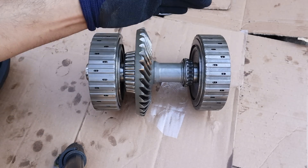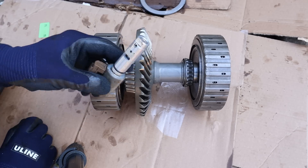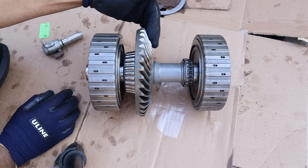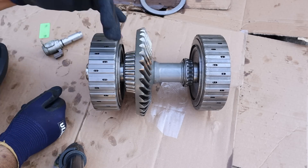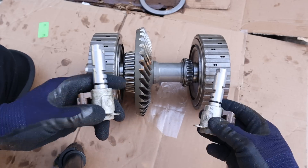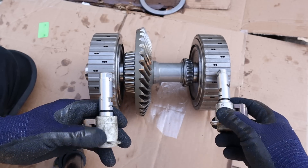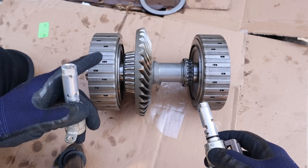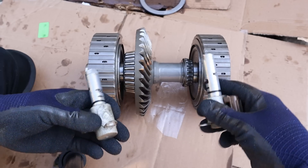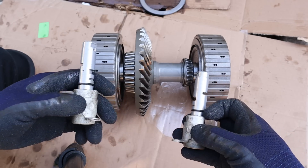Now let's say the vehicle is taking a right turn and you want to power the left side wheel to give the vehicle a little bit of yaw so it can rotate and handle a bit better. The computer is going to apply a little bit of pressure to this oil control valve to this clutch pack and lock it up. That means 100% of the torque being sent here is going to be locked up and sent out to the left wheel, because the input — the ring gear — is going to be locked to the output which is the axle. However, you actually have two clutches on either side and two oil control valves, so through pulse width modulation you can vary the torque split between the left side and the right side — applying say 60% of the power to this side and 40% to this side just by controlling the oil pressure in each clutch. That means you can instantly vary the torque going to each side based on wheel speed sensors and the yaw rate sensor to get way better handling.